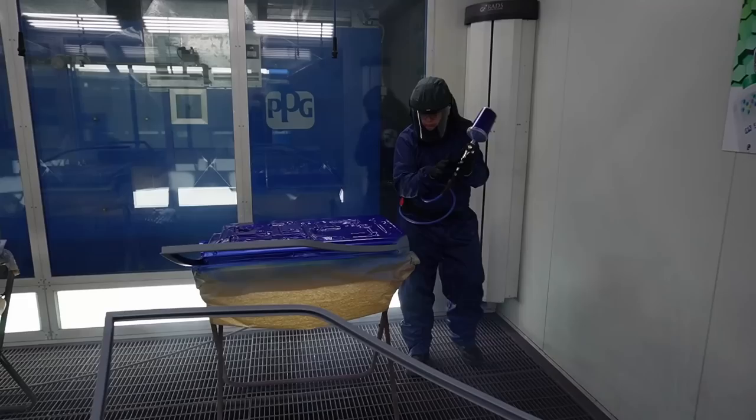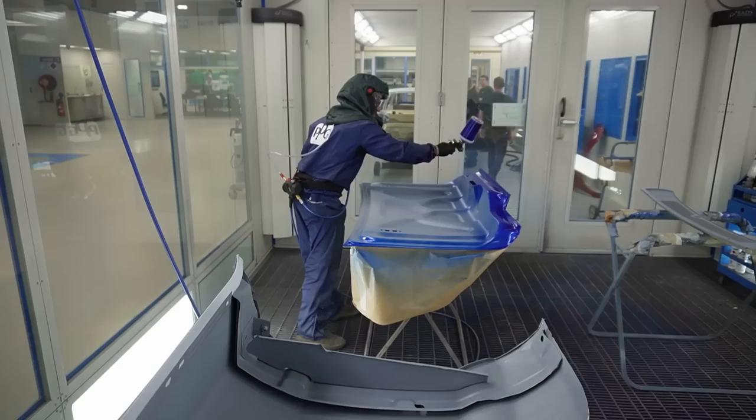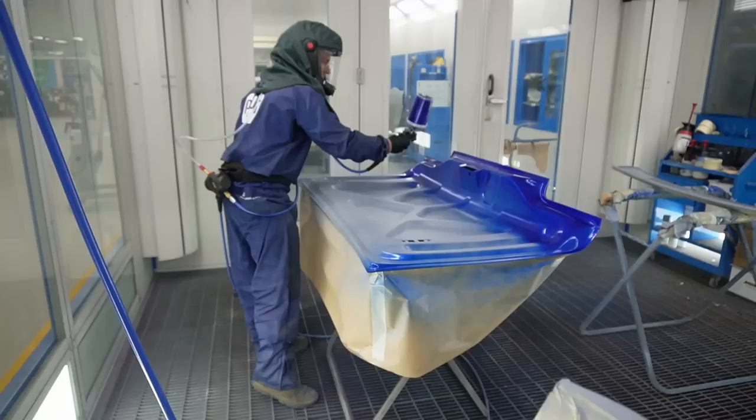What we do is we put a little bit of hardener in there, some of the hardener you'd use in your clear coat, and that little bit of hardener helps. It's almost like a glue. It sticks to the surface really well and gives us a little bit more gloss in our clear coat, and just gives us that really good adhesion in between the layers.